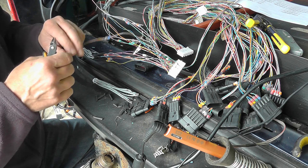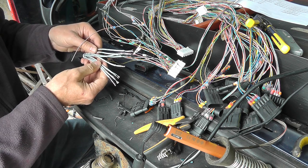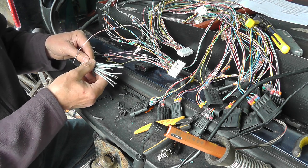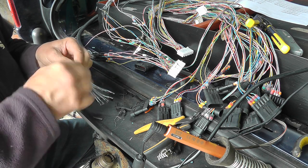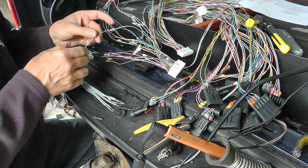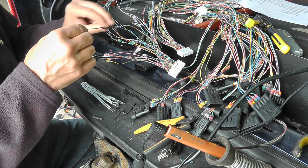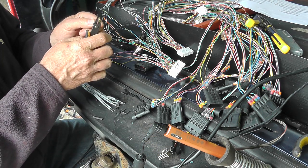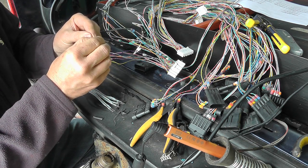So we'll start with 61 and we'll go to cable number 1 in this 8 core. If this has been used for a microphone, then this would be microphone 1, microphone 2, and so on, because they're all labelled. Twist these together, because they've been doubled up, and bend over the end to form a little hook. This one, put on some insulation, and a smaller one, strip the end, and also form a little hook.